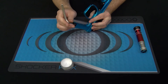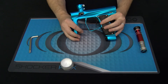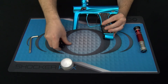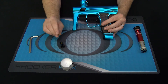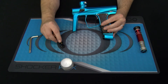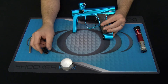I'm going to set my tool aside, and with everything just like that, I'm going to turn the marker upside down so I can pull the parts out. What has come out is the pressure release valve assembly. The cap may come off — go ahead and set it right back down for now, o-ring side towards the little brass nipple here, and set that aside.